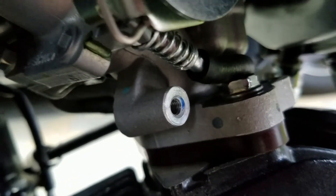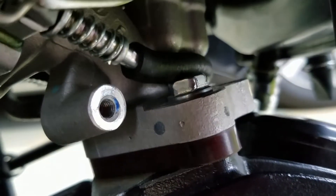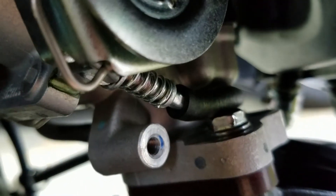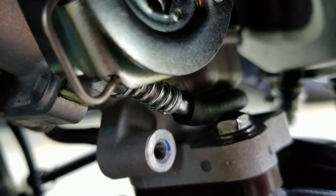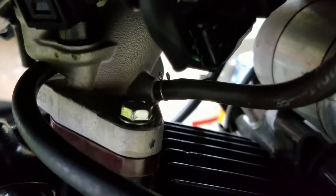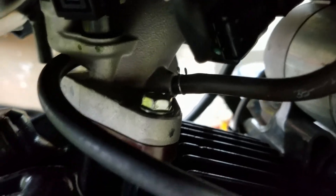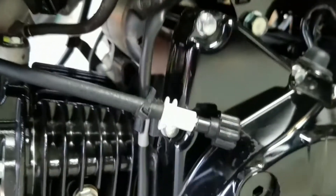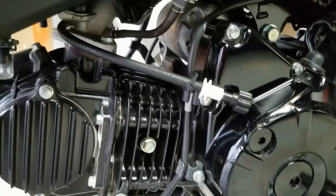You want it to be seated, and then you should be able to screw it in by hand basically all the way until it becomes flush with the top of the throttle body. If it doesn't, then you're misaligned — there's a third bolt right there. You can loosen that and twist the throttle body to get the other screw aligned. I have it zip tied right there, which makes it easy to access from the side of the bike.